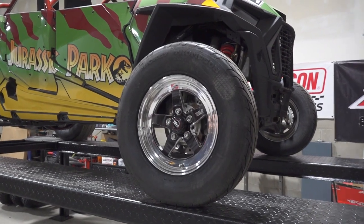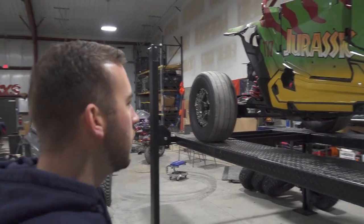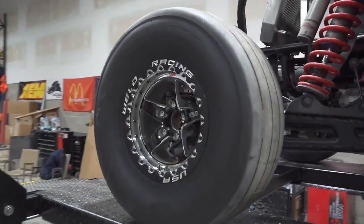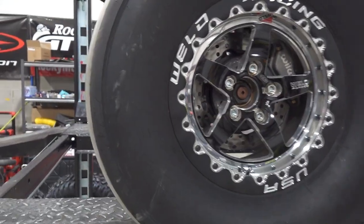You might also notice JP sporting some welds. We showed these before but didn't get to show what they can do with these tires because the Houston event got cancelled. We had this thing all queued up for quarter mile racing in Houston, but that didn't pan out. We're heading to Florida - Monday through Thursday there's a test and tune event at Bradenton Motorsports Park. We've got the big dog quarter mile gear in it, radials out back. Should freaking rip. We've got Weld RTS forged rims up front and RTS forged beadlocks out back on a 295/65/15 Mickey Thompson ET Street R.